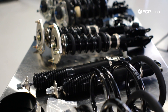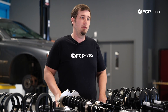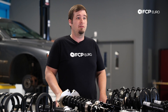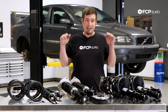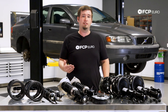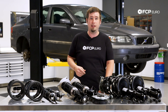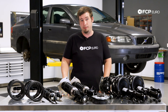For Volvo models equipped with the 4C active suspension, your options are a little bit more limited. When those fail, your car will handle like total garbage, and you may also get a fault code. Although technically you could replace these with standard struts, you will be faced with a chassis setting service required fault code on the dash every single time you drive the car. And remember, 4C also manages the engine and drivetrain settings like throttle response and shift behavior, so there's more involved than just a warning message if you decide to swap to a standard style suspension.